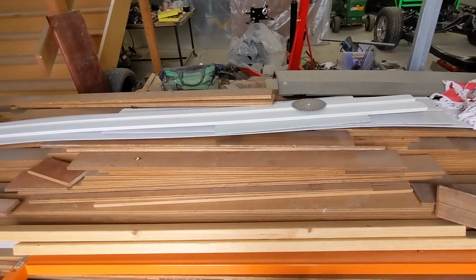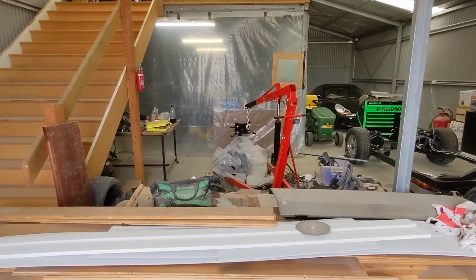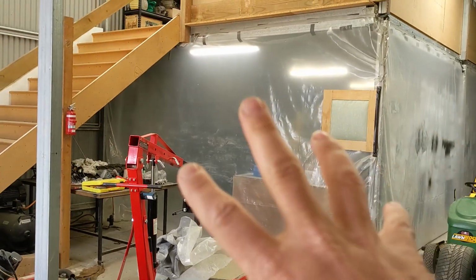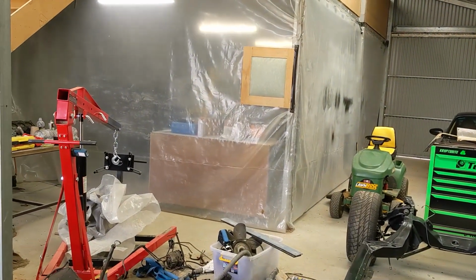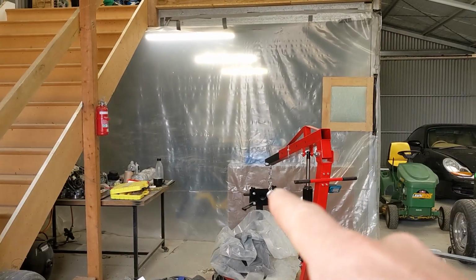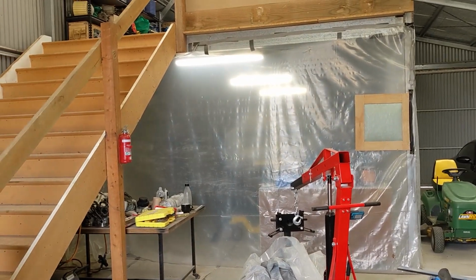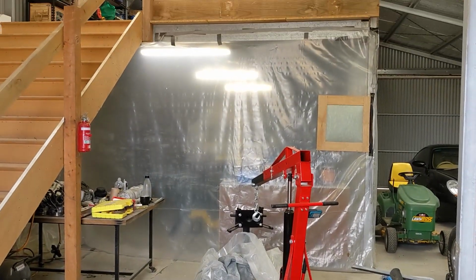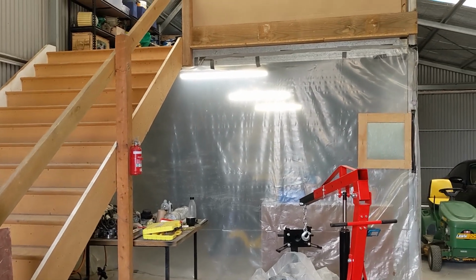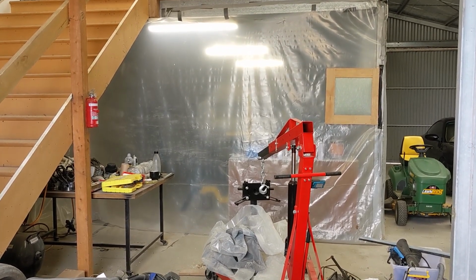But anyway, in the meantime, I've got to get this out of the way and clear all this area so that I can start to prep the chassis to get in there. And that's the mission that I have. Do most of my sanding work before this goes on. And then once it's on, I will probably wheel it out so that it's not getting dust everywhere. As I'm going to be spraying in here, I know you should never do your sanding in a booth. Obviously, I don't have the luxury of doing that elsewhere because of this wood, so that's why I've done that. Come to spray time, I'll give it a thorough clean, wash down, which will take probably a day in itself, and that way it'll be as clean as possible before we start to do the base coat. So now I don't even know what I'm going to do, but I'm going to start something.